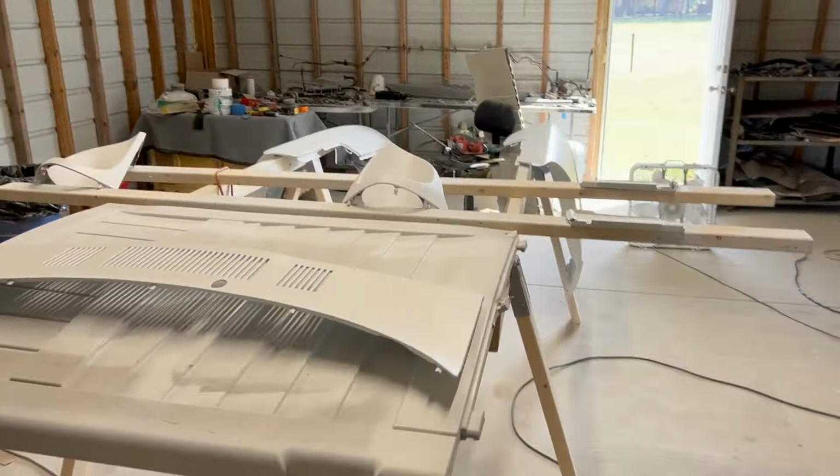What you're going to see is a very uniform speckling in the paint. It's going to look like tiny little dots, and they're going to look uniform. It's not dust, because dust is random. Dust is not going to settle on your paint in a very uniform way. Solvent pop will. The dots are spaced apart maybe a few millimeters, but it's very uniform on the whole entire panel. And you can't get rid of it. You're not going to be able to sand it out or buff it out. It's in the clear, all the way down to the base of the clear.